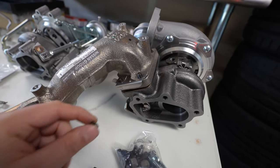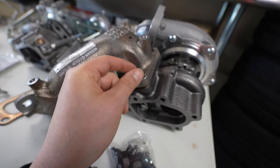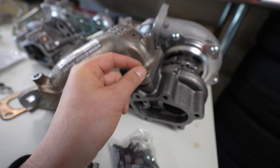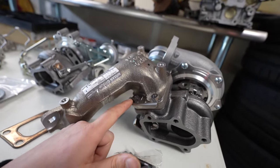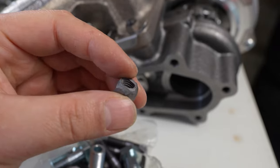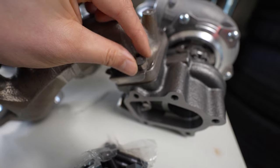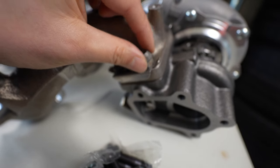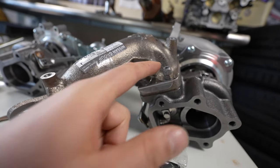Let's look at a couple of the nuts from the turbos we removed. As I mentioned, the lock washers aren't included, but they're important — through all your heat cycles as the turbos heat up and cool off, you want to make sure you have these on your car. The turbos do come with hardware in the box, and they have a little taper towards the top.